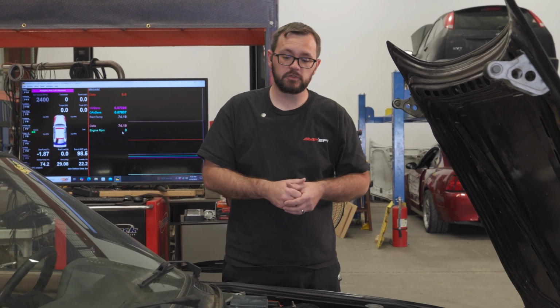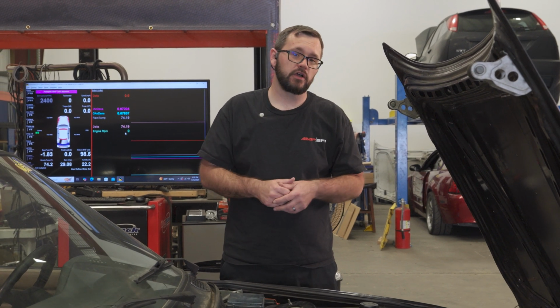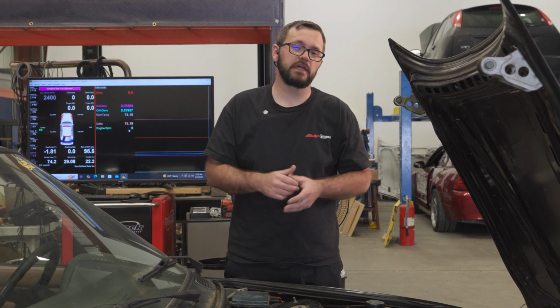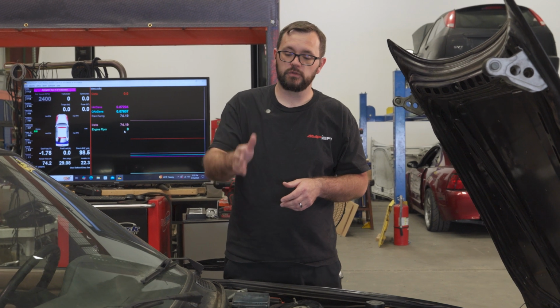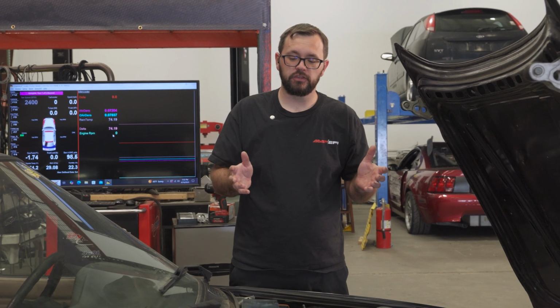We're also testing some new products. So today I'll have some EGT numbers on screen. We won't be doing anything with that information yet today. I am also testing our new AMP-EFI wideband O2s. All signs point to good on those, so hopefully we'll have that released here shortly. So today what we're going to do is convert the tune in this from mass airflow to speed density.